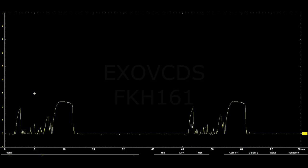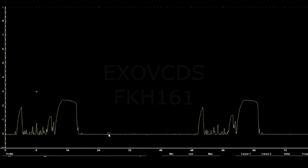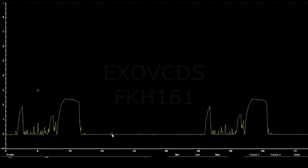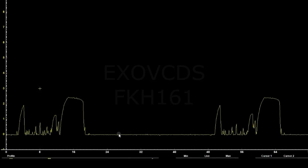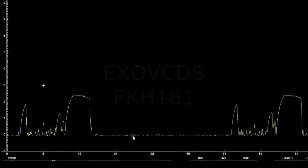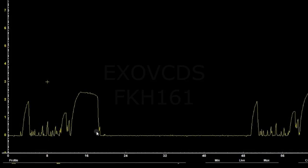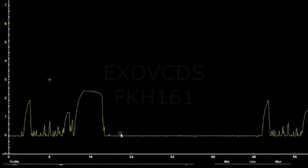It was quite noisy, running rough where it was just making slight contact and electricity was moving. Because of the dead space, once the vehicle is shut off, odds are the next time you start the car the pump would not pump. Since it's only a transfer pump, it's not really an issue until you lose prime in the fuel filter going up to the high pressure fuel pump. This PD engine does not have a fuel injection pump at the front doing the sucking from the gas tank — this transfer pump supplies the fuel filter and then the high pressure fuel pump.